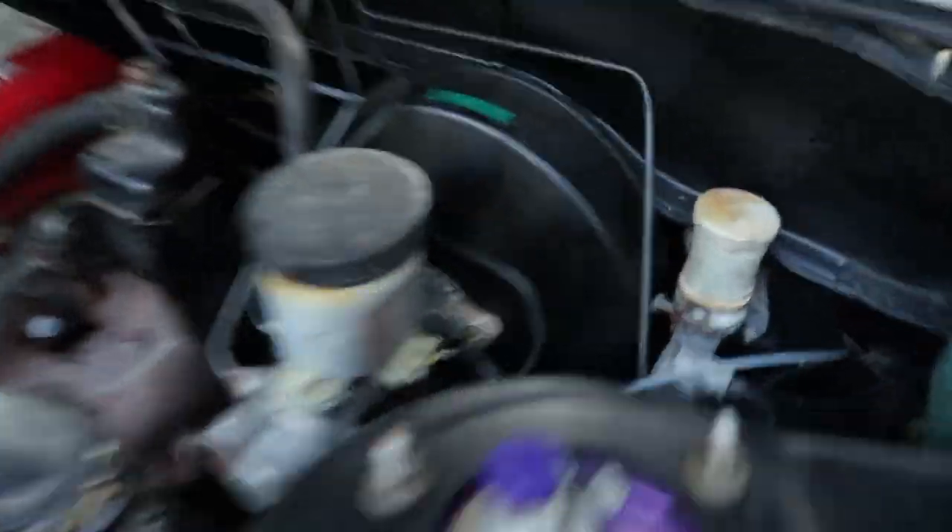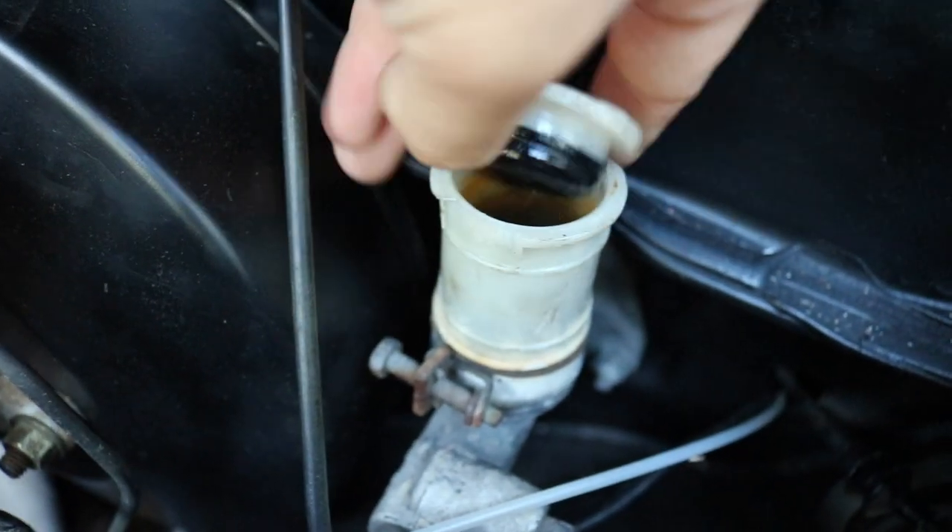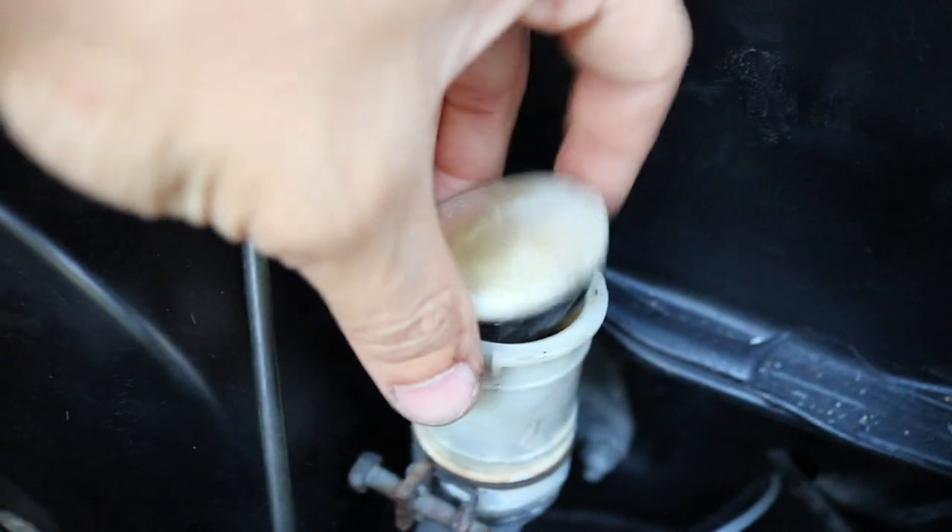Under the engine bay we're going to be bleeding all the air out of our clutch master cylinder and the lines. This little reservoir is filled with some fluid but in the lines there's some air — I hope there's no air in the master cylinder itself. We have to bleed all the air out because air is way more compressible than liquid. When you try to push the pedal to the floor to engage the clutch or the brakes, all that air inside the lines compresses and squishes down so nothing really happens — your calipers don't grab your rotors and your clutch doesn't engage.